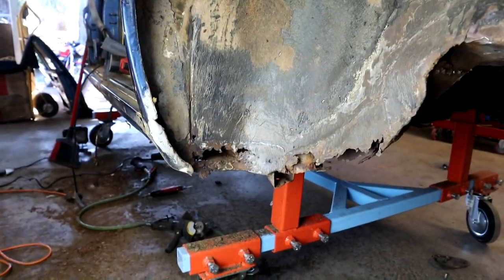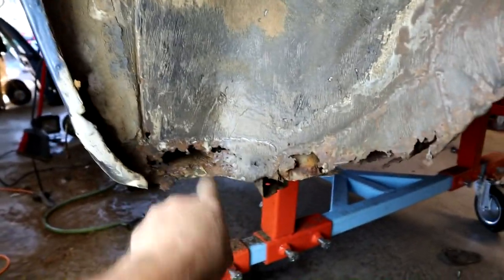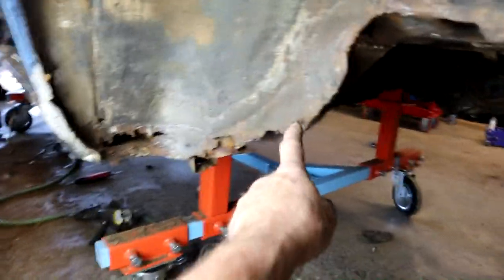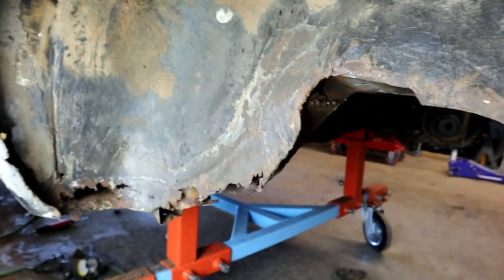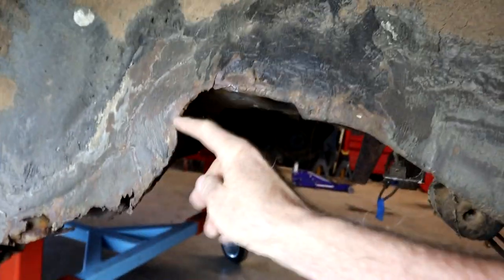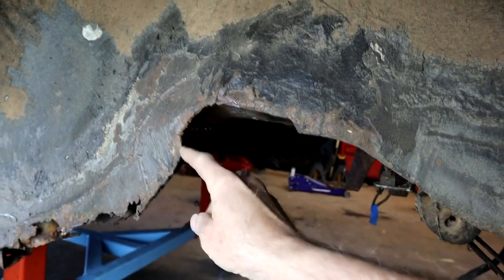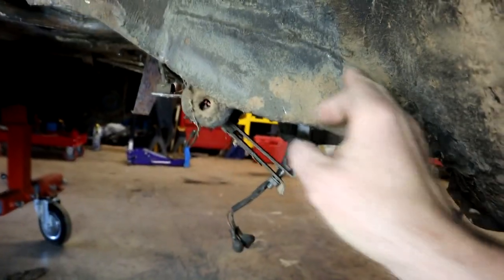Look at this lovely mess. Again, someone's patched it straight over and that patch has just rotted away. This box section has been badly repaired before and rotted away from itself. This looks very similar to the other side — possibly on the 108/109 model this little arch was cut away here, so I want to make sure I get this right. There's another patch here, poorly done, and all this sealer has got to come off to reveal the damage on the inner wheel arch.